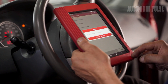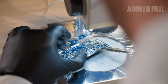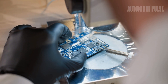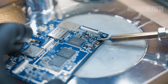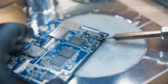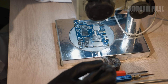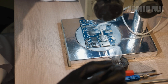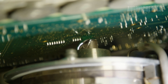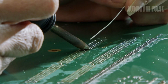An RC circuit, consisting of a resistor and capacitor, can be used to smooth out the signal from an O2 sensor, making it appear more stable than it might be in reality. This method involves connecting both components to the sensor's wiring to create a circuit that charges and discharges, providing a less erratic signal to the ECM. This can be particularly useful when dealing with a sensor that fluctuates too much due to a fault but isn't recognized by the system as failing outright. Setting up an RC circuit is more complex, requiring knowledge of electronics to solder or connect the components correctly. The capacitor acts to smooth out voltage spikes or drops, making the sensor's output look more like that of a healthy sensor.